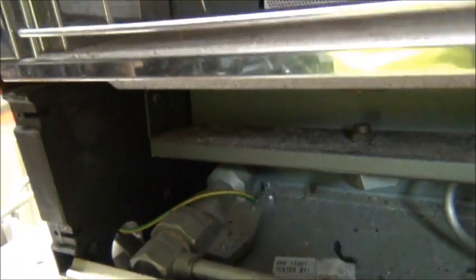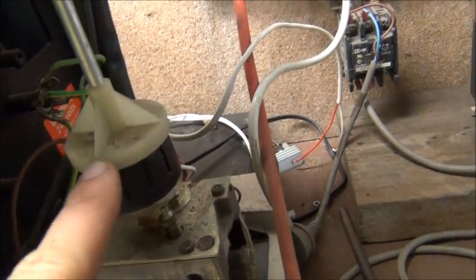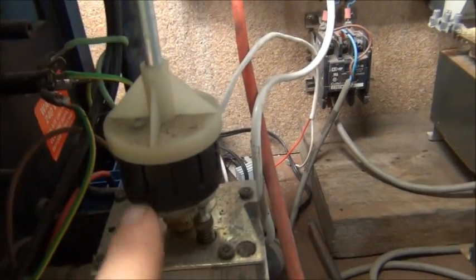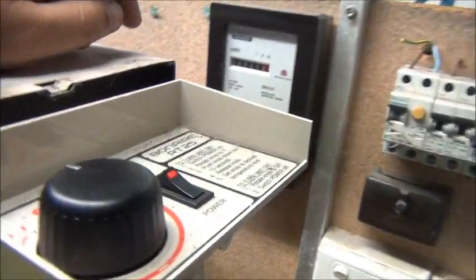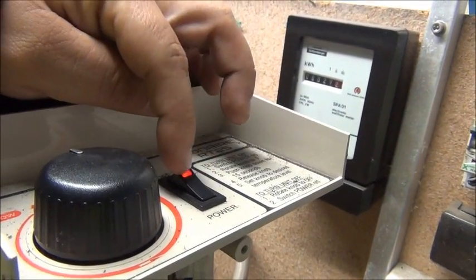There's another piece of match and bit of ash. The burners themselves are in pretty good nick — no real problems there, but bits of ash and bits of match everywhere. Now the gas valve there — it's literally a gas valve out of a hot water heater or anything like that. They've just screwed an extension on top of the knob and it comes up here to the control panel. The power switch turns the fan on and off.